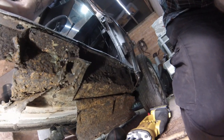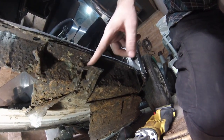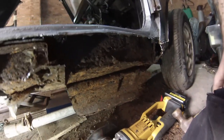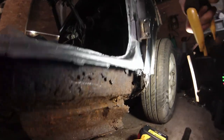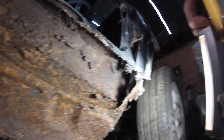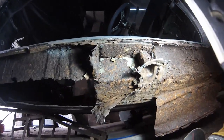You're going to have to get someone, some professional - maybe another mini channel - to judge whether that's actually saveable. I'm guessing the jacking point, so it's hard to judge. It seems quite solid, it's covered in rust dust. There's something around not so solid but that's just this inside piece. If I cut that out like I've done that, maybe it'll be okay. Optimism. Then obviously do the inner doorstep and the inner sill. We'll seek some professional advice and see what they say - they'll most probably say scrap it, which will be sad.